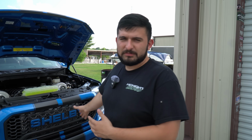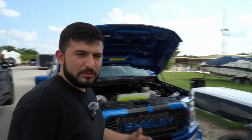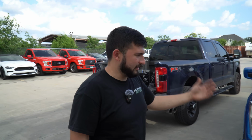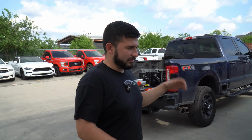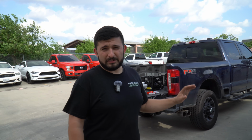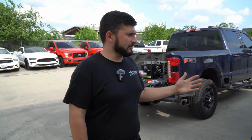Alright guys, so there's a big chunk of footage missing to this point that we are at now. If you have it on social media, on Facebook, Instagram, y'all seen we've been testing the turbo kit on the dyno. Two nights ago, we went to test it on the street. So far, we've got 767 to the wheels on about 12, 13 pounds. And we went 10.3 at 133 on the street.